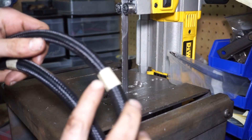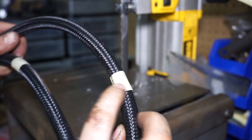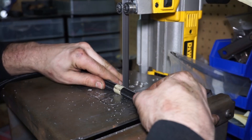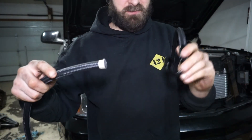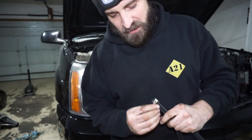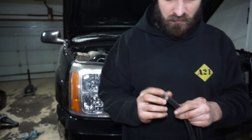What I'll do is use the band saw and cut right down the center of each tape line. I try to do a little bit over one full wrap of tape - not so thick, but it'll still hold the braiding underneath. Then I'll take the opposite end and just blow some air through it - sometimes you can see some chunks fly out. The band saw is actually a pretty clean cut. You can use a cutoff wheel if you need to, but that'll create a lot more dust inside. Just make sure you blow it out and clean it.